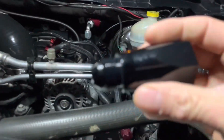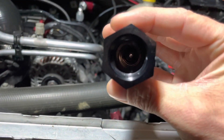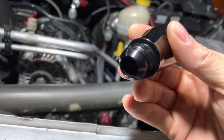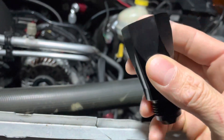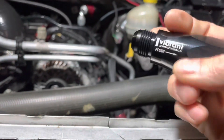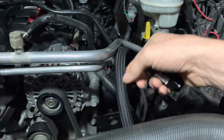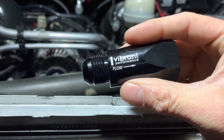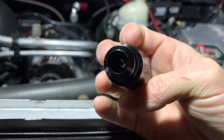What I have here is a check valve — it's a 10 AN male to 10 AN female adjustable ball check valve, adjustable from two to six PSI, from Vibrant Performance. This was about $30. I found the deal I wanted on eBay. This is going to go onto the catch can, and the hose coming from the valve cover goes to here. I have it adjusted to open with the smallest amount of force.